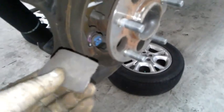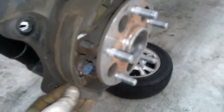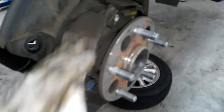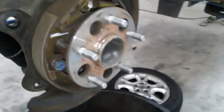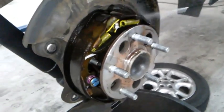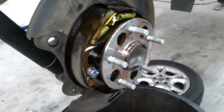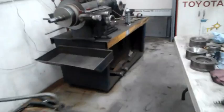Next I'm going to take a little fine grit sandpaper and clean up my e-brake pads — get all the dust clumps off of them and make sure they're just a little smoother, so my rotor will go back on and it'll rotate more freely and have a better grip. I got them all cleaned up. I'm just going to spray them off a little bit with a spray cleaner to get all the dust out of there. You don't have to do this — this is optional. I just do this every time because I'm not usually in that area.